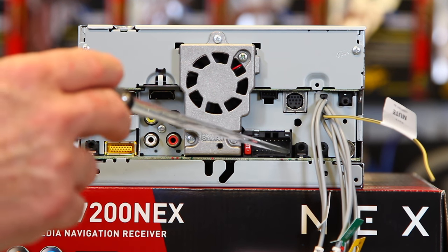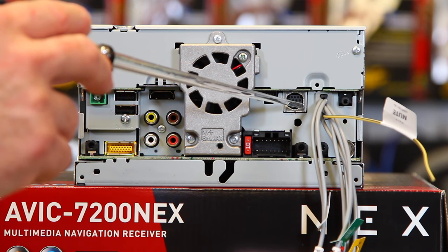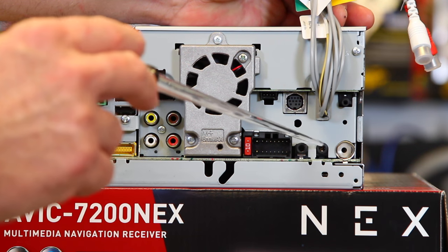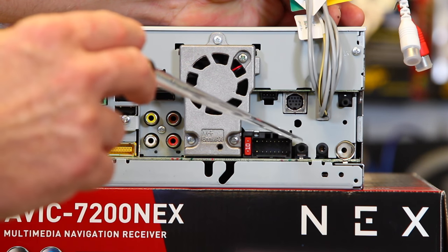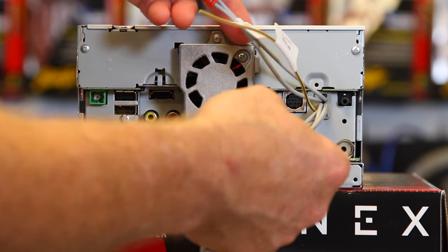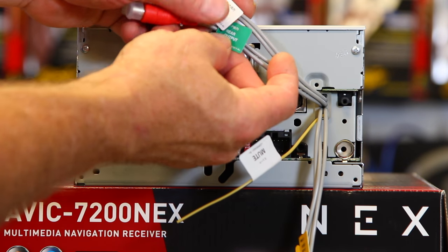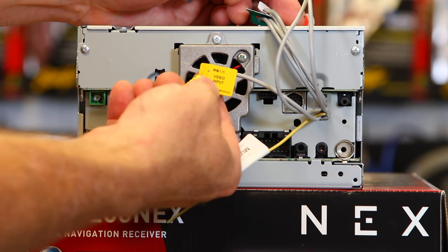On this side of the radio, you have your main wiring harness, your iDatalink Maestro input, your Sirius XM for the SXV300, your Bluetooth microphone input, your main antenna input, your auxiliary input and your wired remote input for steering wheel controls. These are both 1/8-inch size, so make sure you get them right. You have the yellow-black wire which is mute—this is if you have GM and would like to retain your OnStar. You have the white labeled RCA which is your front output, green which is your rear output, then gray which is your audio input, as well as yellow which is your video input.